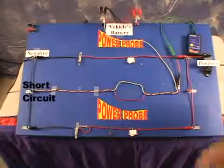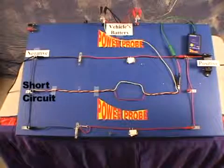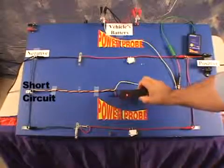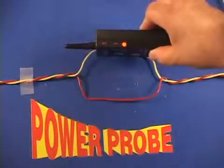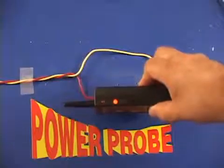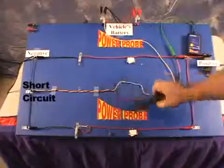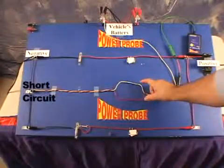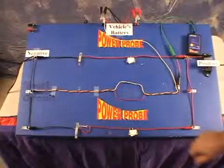As you hold the wires away from the other wires, the signal canceling effect is removed, and the signal strength will increase in that portion of each individual wire. Take note of the direction indicator of the smart receiver and observe if the other wire indicates the opposite direction. If it does, you can now assume that both wires are in the same circuit. Trace both wires as a pair along the harness until you find the problem.